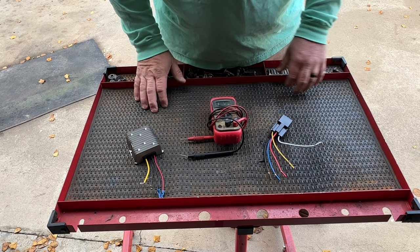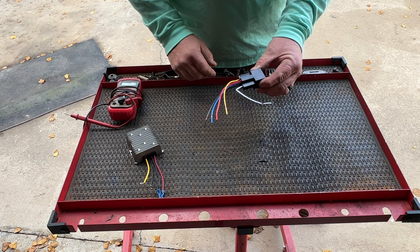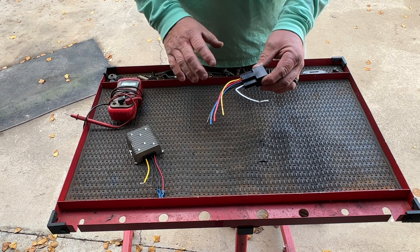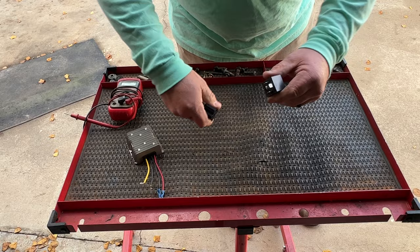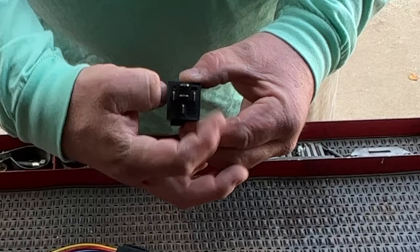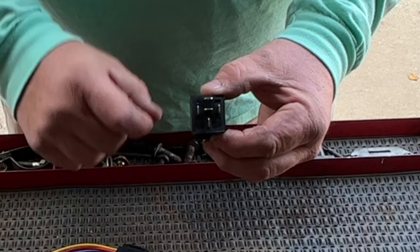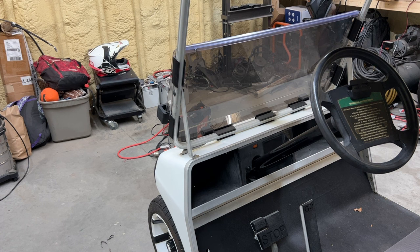This will also work for the blue converter as well, since it still produces 12-volt power even when the key switch is off — with this relay it will not produce anything when it's off, and will produce when it's on. I'll place links to this relay and harness in the description — they come together and you can pull them apart. The bottom of the relay has pin 30, pin 85, pin 86, pin 87a in the middle, and pin 87 on top. We are not going to be using the blue wire (87a) in today's video.